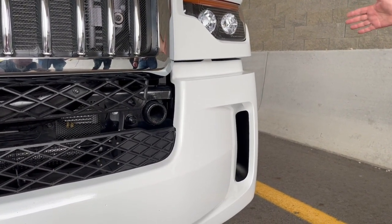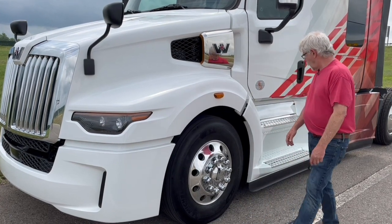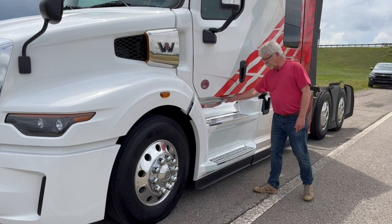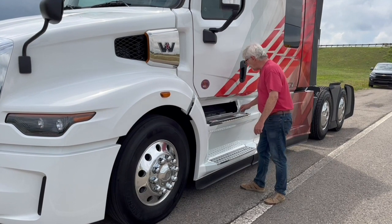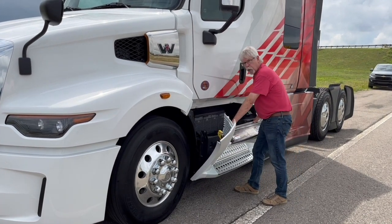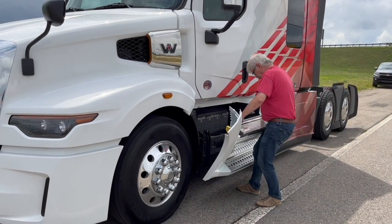I don't think there were any reports of the tires and wheels running hot, but this is certainly going to help keep the inner side of the wheel a little bit cooler, especially in hot weather. Coming back a little bit further here, we've got the side fairing, and hidden below this is the battery pack for the truck. They've designed this in such a way that it's really easy to access. Down inside this little porthole here, there's two latches. All you have to do is lift those latches up, this drops back towards you, and then you literally just lift it off. Set it aside, fix your batteries, and put everything back.